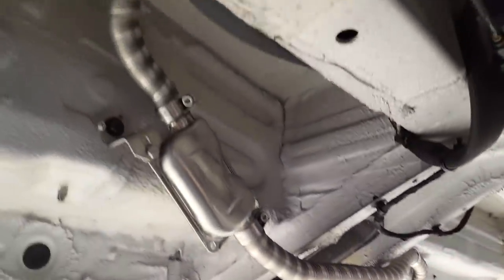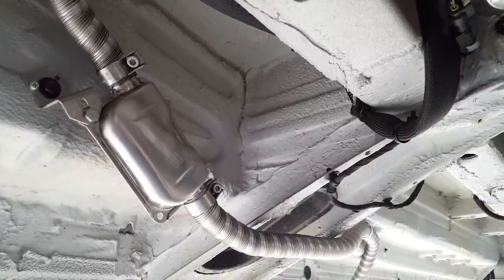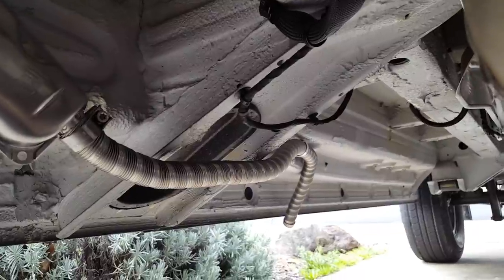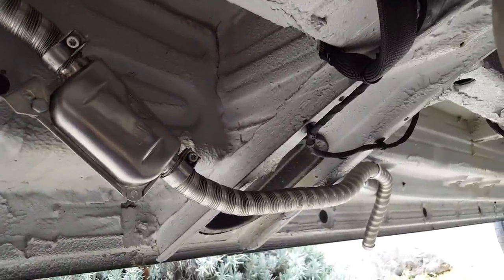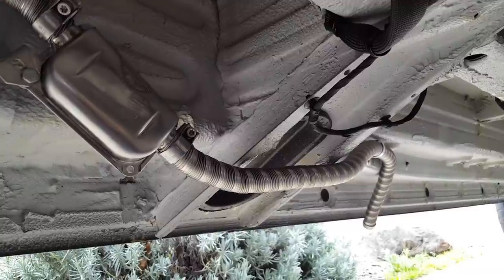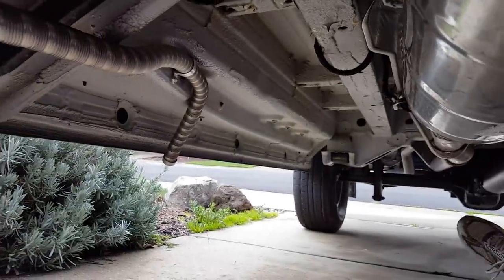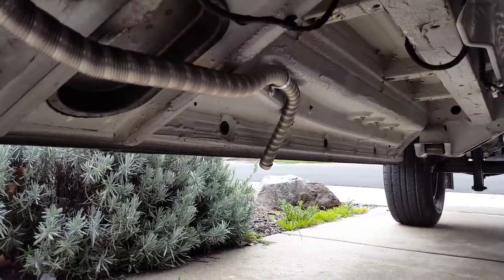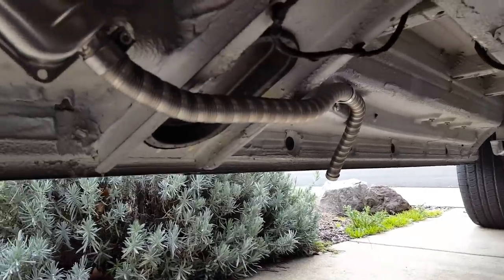So I used all of the exhaust piping that was sent with the kit. And for the system to be a little quieter, you want more piping behind the muffler than before it. So in order to do that, I almost had to mount the muffler in this location. It's fine. It probably looks like it's hanging down lower than it really is, but I'll show you that in a minute. I had considered buying more of this exhaust tubing and plumbing it out the back, but I did read that Espar recommends, especially if you use a muffler, that the Espar wants a certain back pressure, and if you extend the hose very much, you can have trouble. So I don't know. We'll see how this goes. I could always extend the pipe later if I decide to, but for right now, I'm going to leave it.